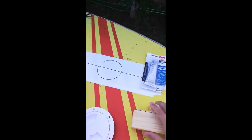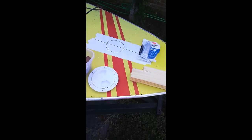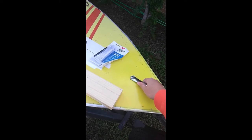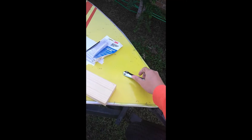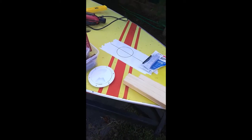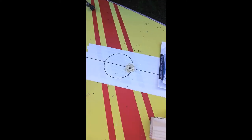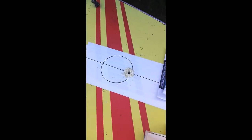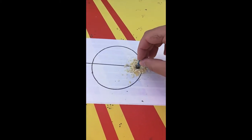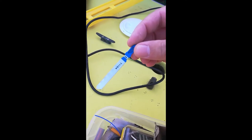I'm not using super high-grade material for the backer block since I'll have access via the inspection port — if I ever need to, I can get in there and swap it out. I do use the bow handle to get the boat on and off the trailer and pull it around at the dock, not usually bearing full weight, so I'm not too worried. The first step is drilling a hole with a 3/8 drill bit to fit the jigsaw blade right in. It fits perfectly to start the cut. Based on discussion boards, it's recommended to use a metal jigsaw blade to cut fiberglass.